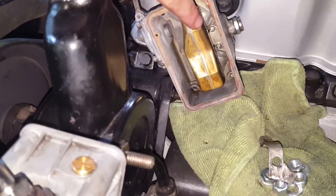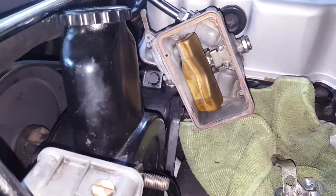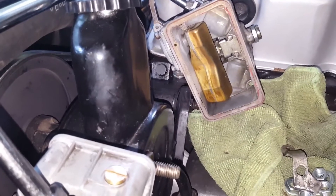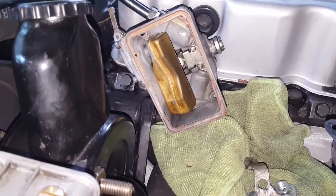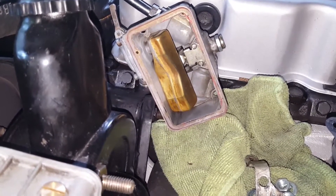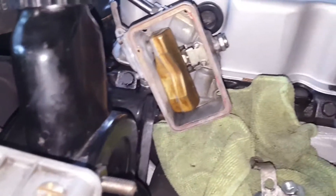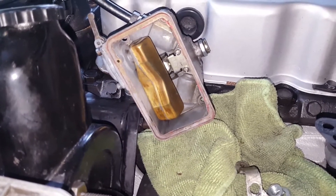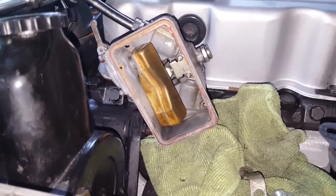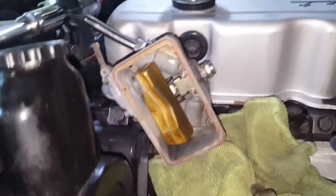Looking at the fuel bowl, I've got a metal hollow float in there. They're great floats — I think they're actually the best floats — except they're not ideal for turbo applications, because these metal floats are known to compress under boost, and if that happens you're going to have issues at all levels of driving. The black nitrophil plastic floats are a little more expensive and they do get fuel-soaked over time, but if you can get a set of those instead for boosting, you'll do just fine. I'm probably going to swap these in before I reassemble.